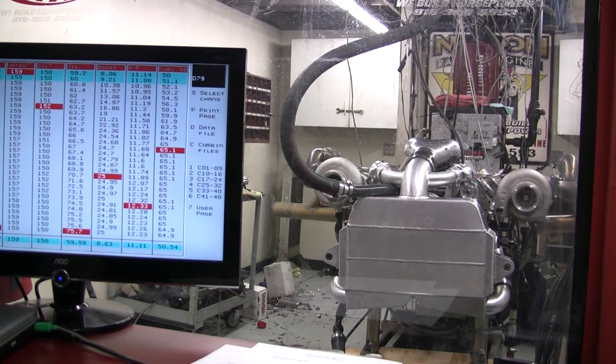How do you know what tells you? There's a water brake. It measures torque. So that's peak torque, and then that's multiplied by a conversion factor to get horsepower. So when torque starts dropping off faster than horsepower is gaining, that's when you know that's it. All the dyno does is measure torque, really, and then it converts to horsepower.